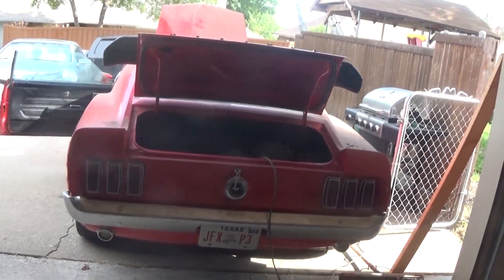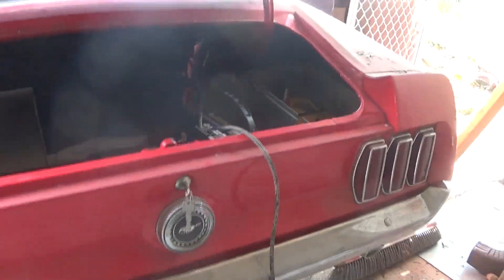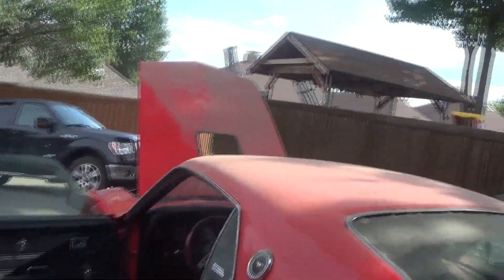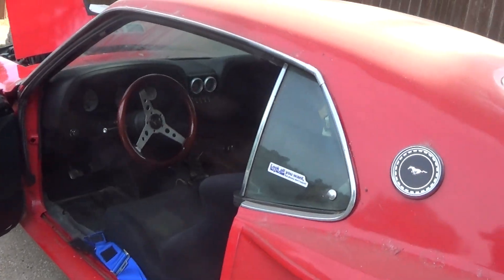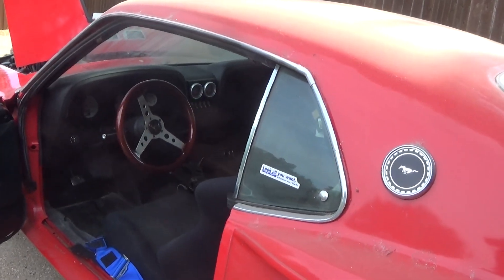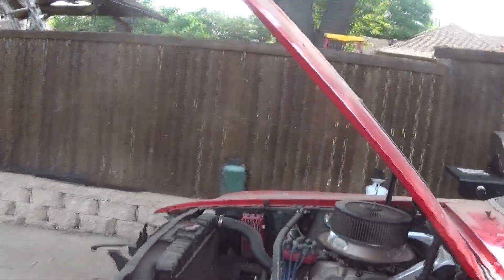It's been two years — this car has been sitting in my garage, covered in dirt and dust. I put gas in it, put in a new battery, and turned it over enough to know I have oil pressure. All of this was done with the ignition disconnected so it wouldn't fire over. The only thing I have left to do before I start it is verify that I've got fuel pressure.